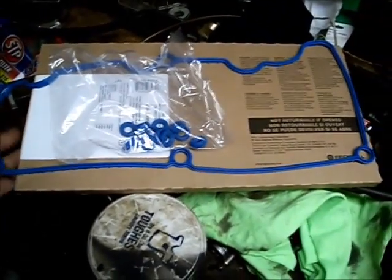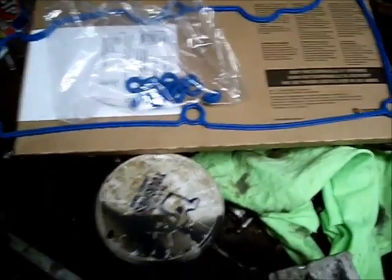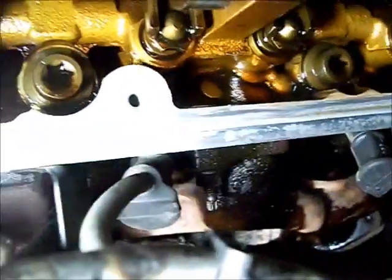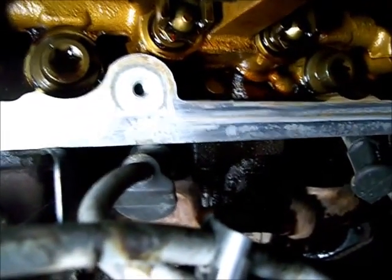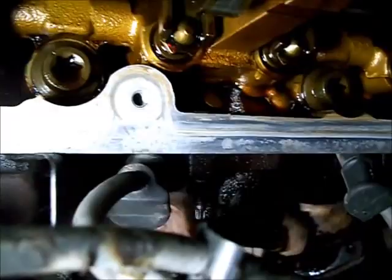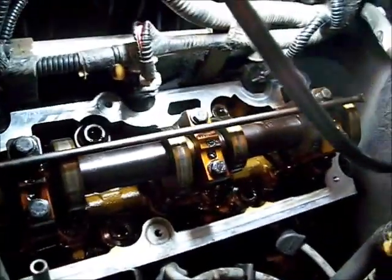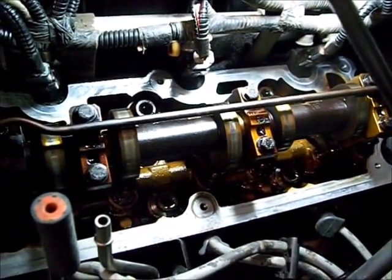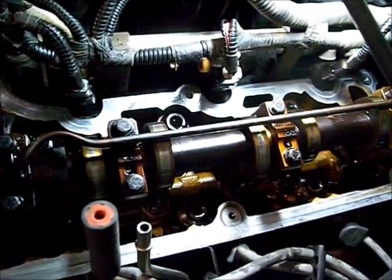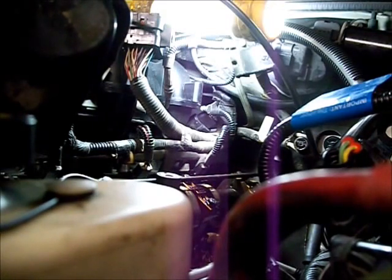Some aftermarket gaskets would look like this — the manifold is getting all oil-soaked, and this section of the gasket was stuck to the valve cover and hard as a rock. I dried any dampness off anything sticking up so it doesn't get on the seal when I fish it back there, and dried up the top of the cam bearings and the lubrication tube.